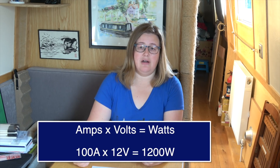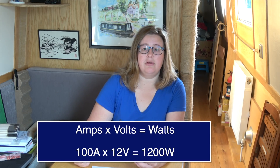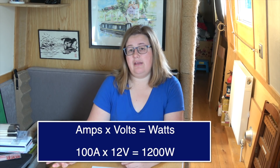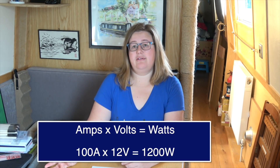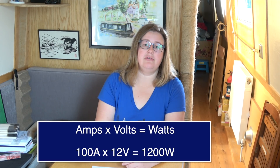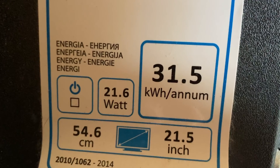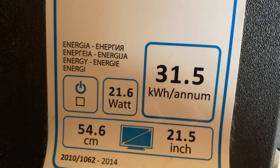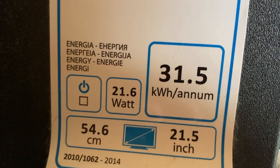For example, if you have a 100 amp battery and multiply that by 12 volts, you get the wattage needed to put all of that power back in the battery, which is 1200 watts. With that simple equation, you can look at any electrical device on your narrowboat — it'll probably have a sticker on the back giving you either a watts or amp rating — and you can calculate the power draw of that item.